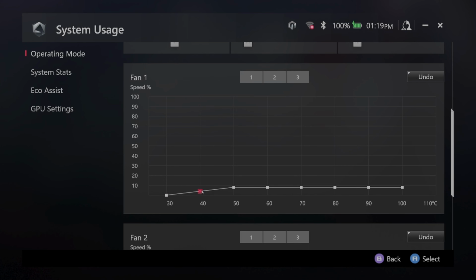So, if you're smart about it, you can set a good fan curve and not wreck your stuff, and not thermally throttle or anything like that. And before, when we could do a bit more of an aggressive fan curve, that was evident, because I had a nice custom fan curve in the older BIOS, and it was quieter than this one because it didn't have that hard lock in place. So it's unfortunate, but that's how it is.